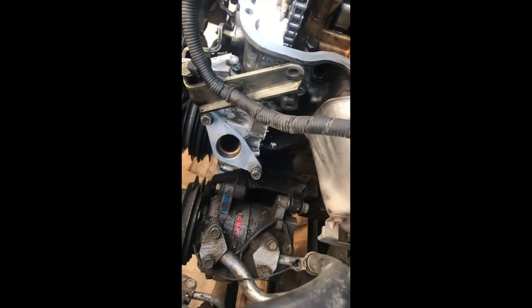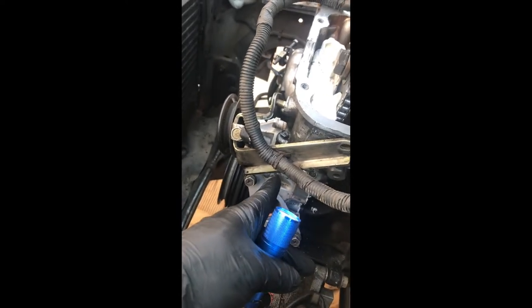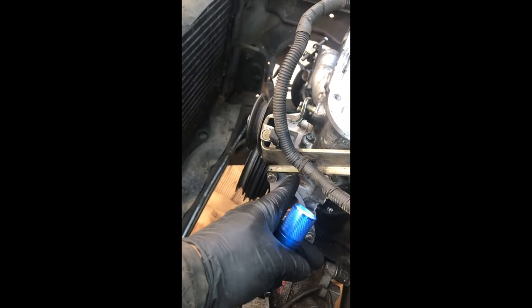I put the oil pump in place with one bolt to hold it. I came in with the distributor to see how it looks inside. I need to make sure when I put the rotor, it's facing in the correct direction. If the rotor faces this way, it's correct — then I'll try the port in the oil pump. Don't forget to put oil in the oil pump before you start the engine.